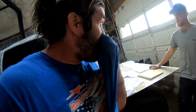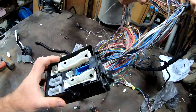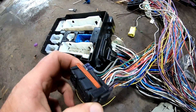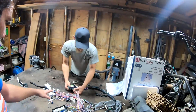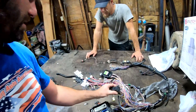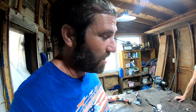We're trying to make a fully functional build — windows, everything works. Yeah, everything's gotta work. Over here in the dirtier part of the garage, a big chunk of this stuff is gonna go in. This is that junction box I'm talking about — it's gonna have to go in the Tacoma. This is the A24 plug for the ECU. That is the four-wheel drive ECU, which is gonna stay right there. It's already mostly ran. That's why we're gonna put most of this stuff in the truck, because it's gonna connect a lot of these wires from D24 — they'll go straight over to the four-wheel drive computer. We want to use the Tundra four-wheel drive computer because it's a little different than Tacoma.